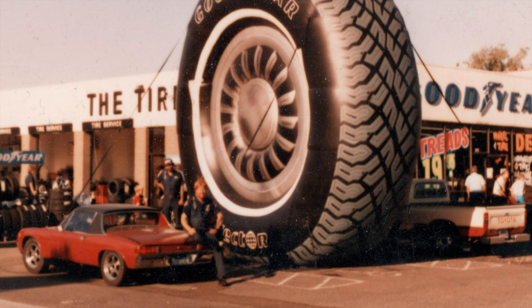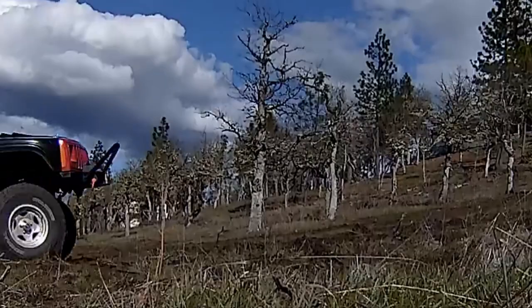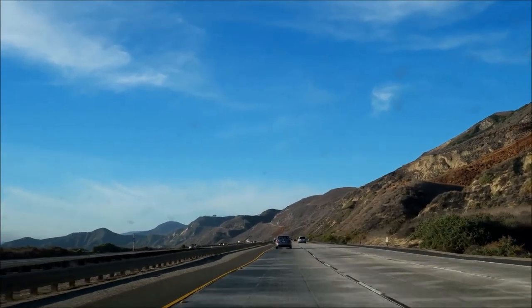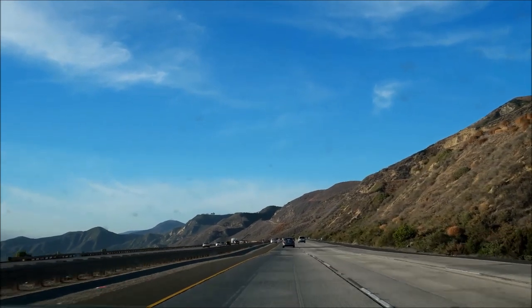Home alignments depend on a lot of factors, so it's easy to get it wrong. If you're doing a trail beater that rarely sees paved roads, that's one end of the extreme. Then if you set the alignment and immediately drive your Honda five days in a row, two hours a day, and you're off just a bit, you're likely to fry your expensive tires before you know it. Most of us are somewhere in the middle. So in other words, do your research, calculate your level of allowable error, and buyer beware — your miles may vary.